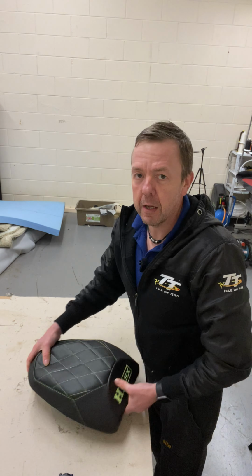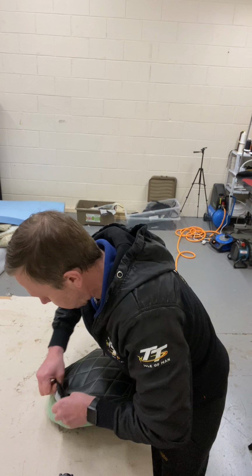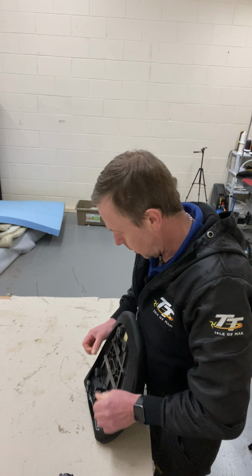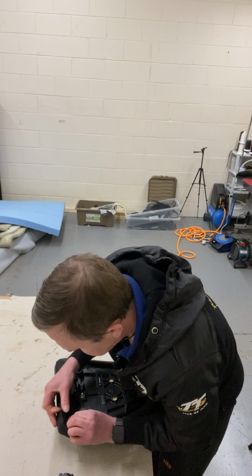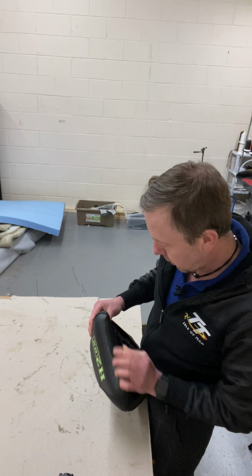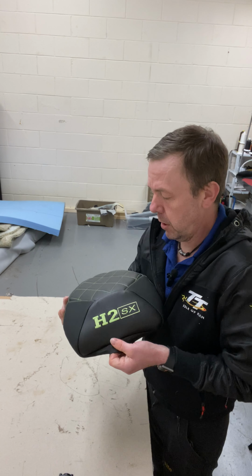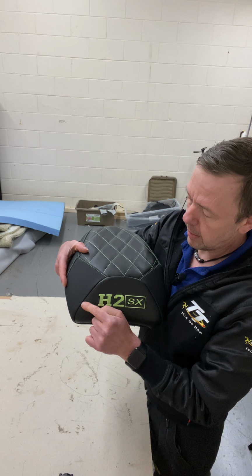They like to do everything themselves, so if they can upholster the seat themselves, then all well and good. I'll just show them how to do it, and if they watch this video, cool. Right, again, everything needs to be central, so that seam there on the corner. It's very important for that to be centre, or it'll just look rubbish. Also, this seam here, you can see them lumps, you need to fold the seam out.